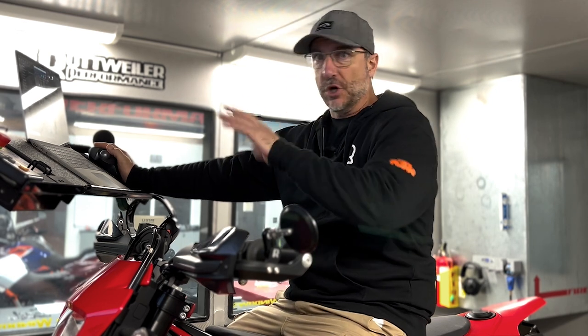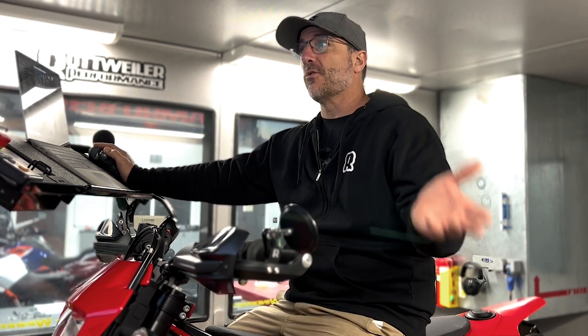Now, if this is a race bike and it's a short course and you're racing the thing, sure, tune it to make as much power as you can. You're not concerned whatsoever about fuel consumption, so long as you don't run out. Now, in desert racing or that sort of thing, yeah, you're concerned about fuel consumption because you've got X amount of distance between fuel stops. So you might want to lean that out a little bit and focus on a slightly leaner but not so lean air fuel ratio range.